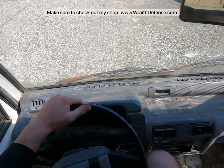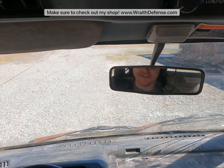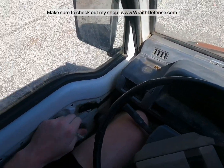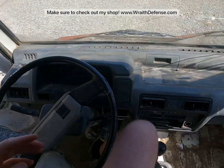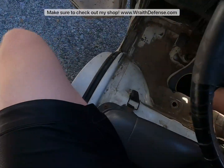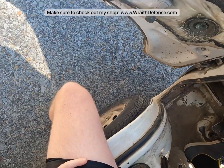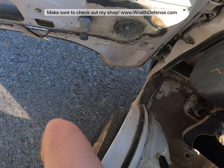Okay, well, I believe that is everything I need to do to the vehicle for today that I have parts for. In the next video, I'm probably going to look into whatever is making this big old dead spot in the steering wheel, because as you can see here, I am swinging the wheel and we ain't got nothing, which means I'm imagining something in the pitman arm, some bushings, ball joint, something like that. Nothing too crazy.